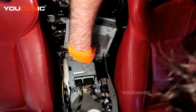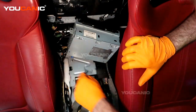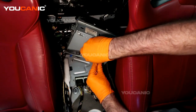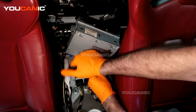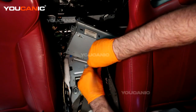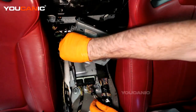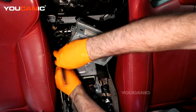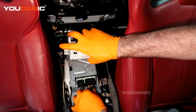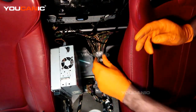With the four bolts out, take off that cover plate. We have the electrical connections and one bolt down here, one bolt right here — those are size 8 millimeter. There are size 8 millimeter bolts holding the airbag module — or SRS module — in place. We have three total bolts, with one more in the back.